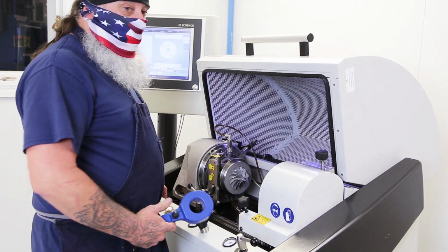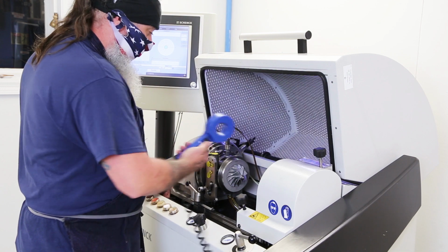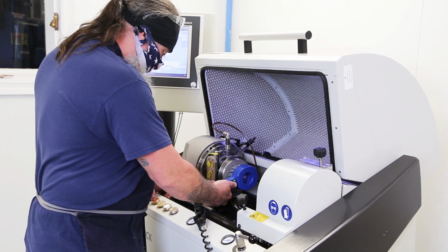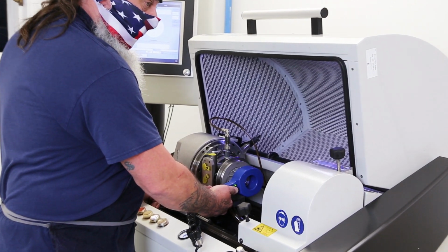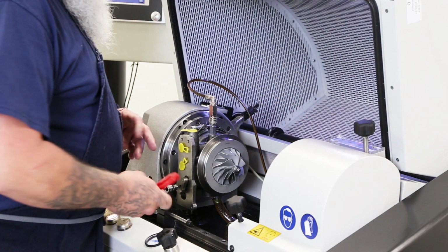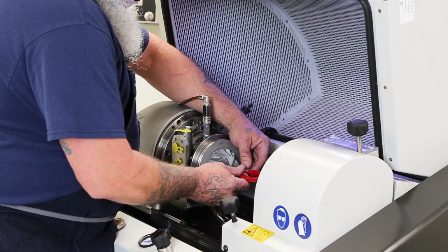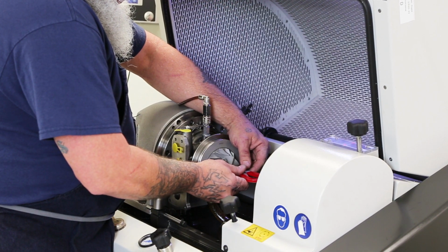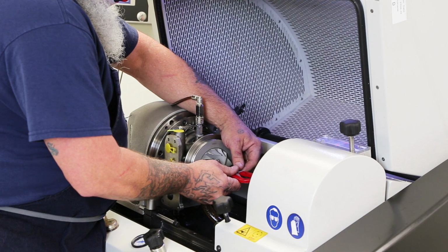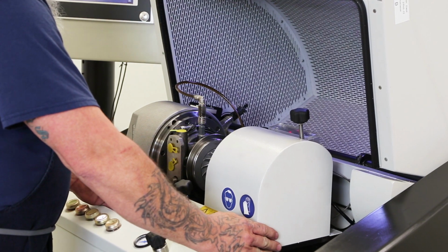We'll inject with oil, which brings up oil and fills the cartridge full of oil. This is a demagnetizer, to demagnetize and then remagnetize the shaft. This thing works a couple of different ways. It works on vibration, and it works on magnetic. That was a demagnetizer. Now we'll remagnetize the shaft, which is just basically taking a magnet and pulling it back and forth off the shaft to remagnetize it. Should be good there. Now we're going to bring this in. This is set for this already.